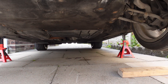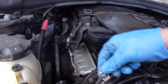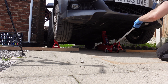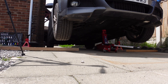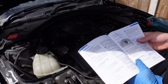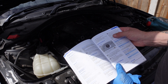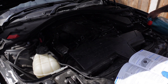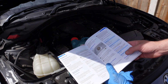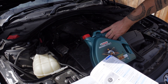Make sure everything's clear, all those nuts are back, and everything's out from under the car. Line up your blocks again and drop the car back down. We can now add some new oil. Check your owner's book for what to use — I've gone for 5W40. You need to make sure it's either C3 — it says here it's got to have long life LL04, but if it hasn't you can top up with C3. This is C3 and it's got its long life LL04 as well — fully synthetic, says for BMW.